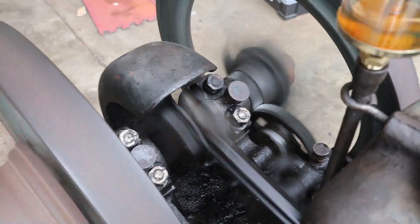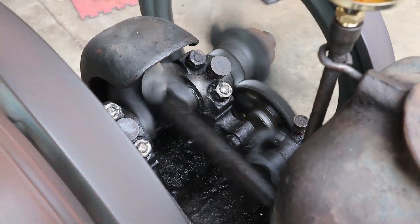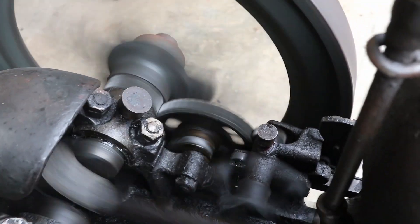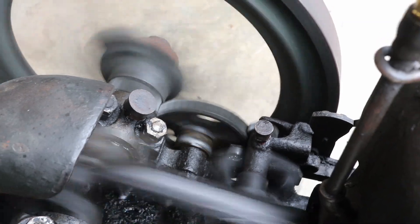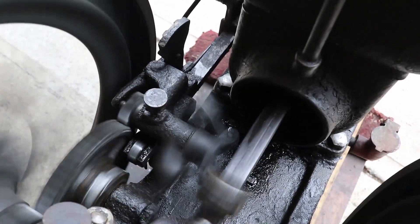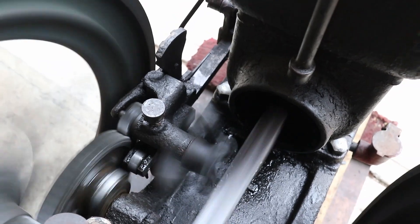Here's the end of the connecting rod moving the crankshaft. If you look, there's a gear on the side of the crankshaft which is turning your cam gear right there. You can kind of see the cam lobes on that. And then that cam gear is actually turning another little gear that is spinning a governor. The governor there has the weights that are spinning, kind of blurry there.